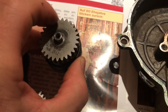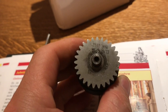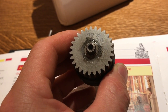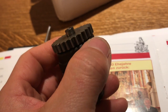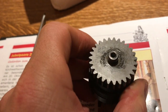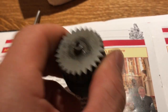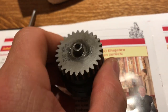They now make this with 28 teeth welded on. The part number you need for the bendix is 551 400 264 00. For the crown wheel it's 551 400 223 00. I'll write all that down. I've ordered those from a company in Europe — I'm actually in Austria at the moment — so they're on their way to me.